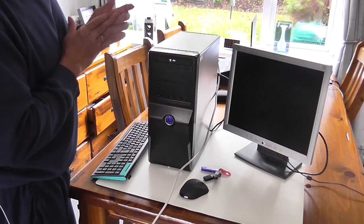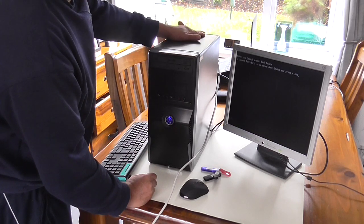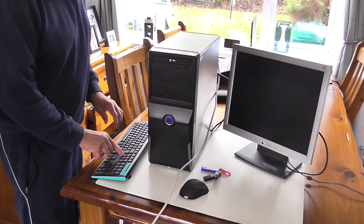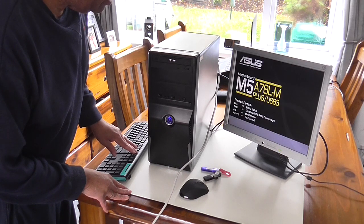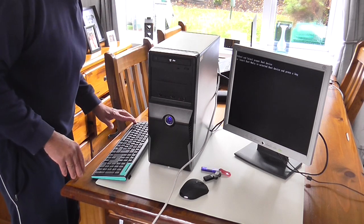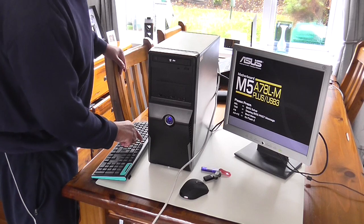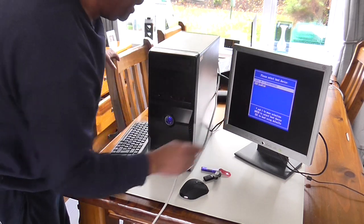Now this will either go into the BIOS, or it'll say there's no boot drive, or it'll find the right boot menu, press the key. Right, so what I need to do is mash Del. Is it F12 for boot device? F8, boot menu, F8. Right, okay, I've got it now. Hold Del, and we're going to be mashing F8, and see if it recognises my flash drive. There you go, USB SanDisk. There we go, that's what I wanted.